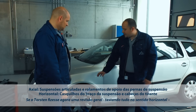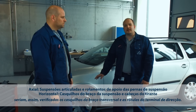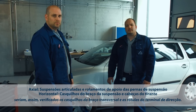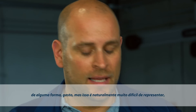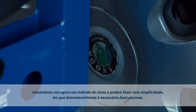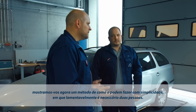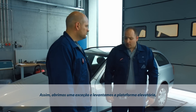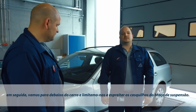If Torsten wanted to check control arm mounts and tie rod ends, all he would have to do is position the tester horizontally. It is very easy to feel whether or not a bushing is worn, but obviously difficult to see. So now we'll demonstrate an alternative method which, unfortunately, requires two people to make it work. We'll take the unusual step of lifting the platform to take a look at the control arm bushings from underneath the car.